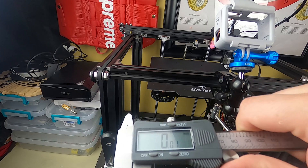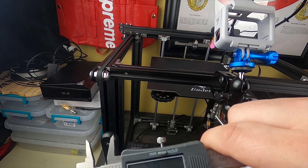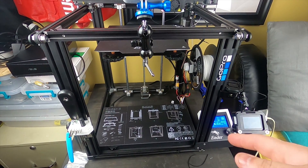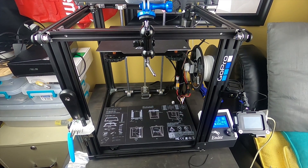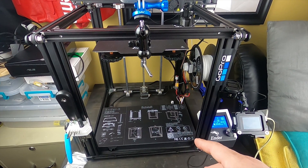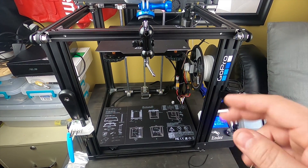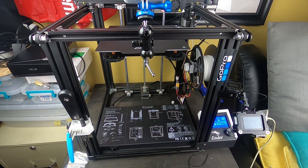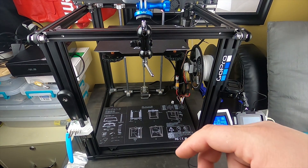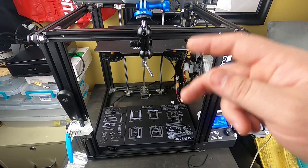I'd say that's a success. Let's zero this out. Go ahead and check — Z is 20.78, X is 20.13, and Y is 20.07. Okay guys, thanks for watching me install the silent board. As you can see, it went pretty easy — it wasn't that difficult at all. Just follow the steps. You can go to the Facebook group to get the firmware and put it on there. That's the factory firmware — I didn't even upgrade anything, it was just ready to roll right off the bat. It's much quieter now. Don't forget to drop a subscribe down below and like the video. For other cool videos like this, I'm going to do the BLTouch next — that'll be next week's video. And then I'm going to do the wire management soon too. Anyway, thanks for watching. Peace.